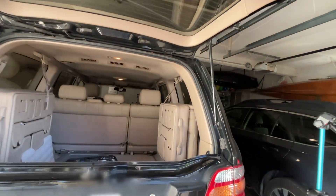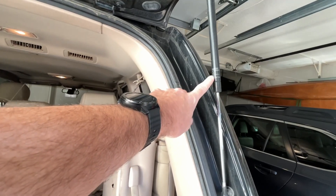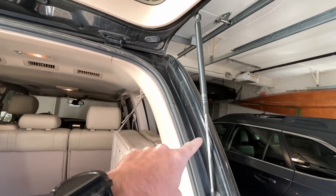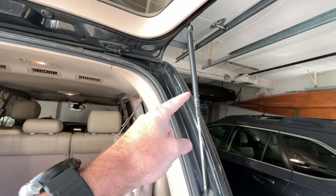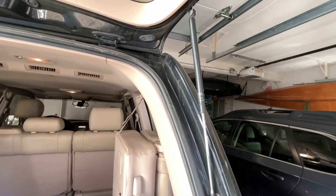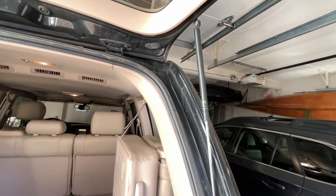In this video I'm going to be replacing the rear liftgate struts on my 2000 100 Series Land Cruiser. These struts are working right now, and I actually recently replaced my hood struts — they weren't working at all — but I didn't replace these at that time because they seemed to be working. But I was out camping in cold weather and these things were not working, so when it got cold the tailgate would barely stay up. It's super easy to replace them, so I'm going to show that in this video.